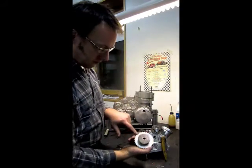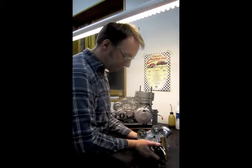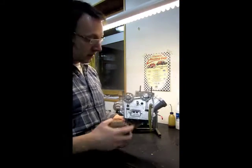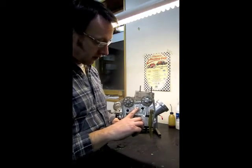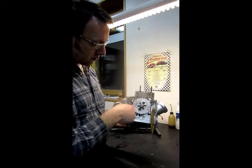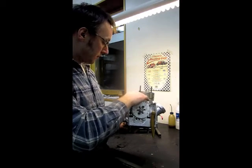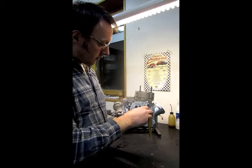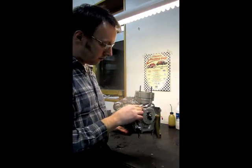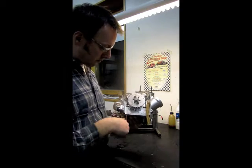You can see the gear here driving the two cams. This shaft is positioned exactly where the OEM camshaft is — the single overhead cam. That makes the cam chain work in a very nice assembly, just like the OEM. And that is also good because you don't have to make any modifications on the cases, either the back one or the front one.